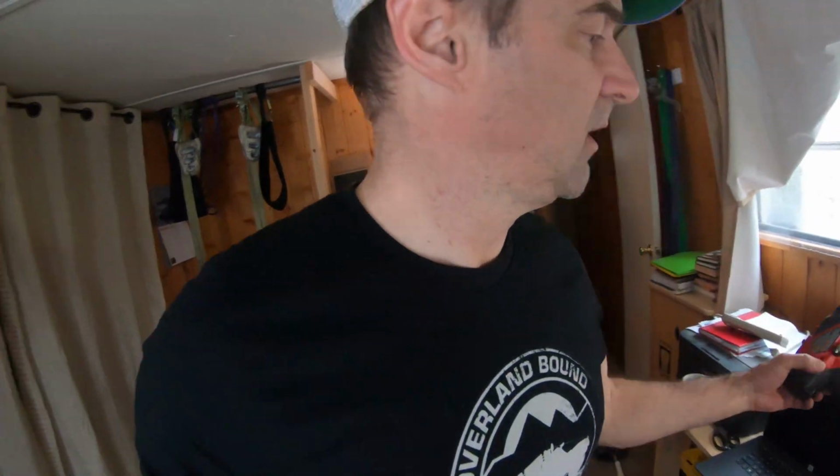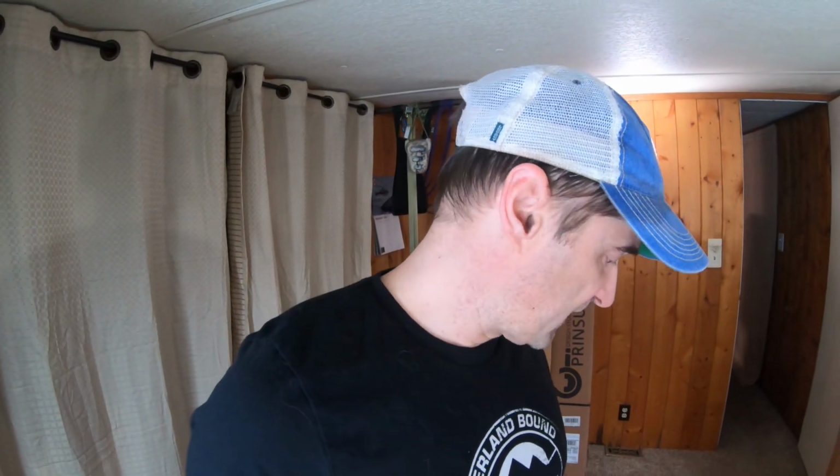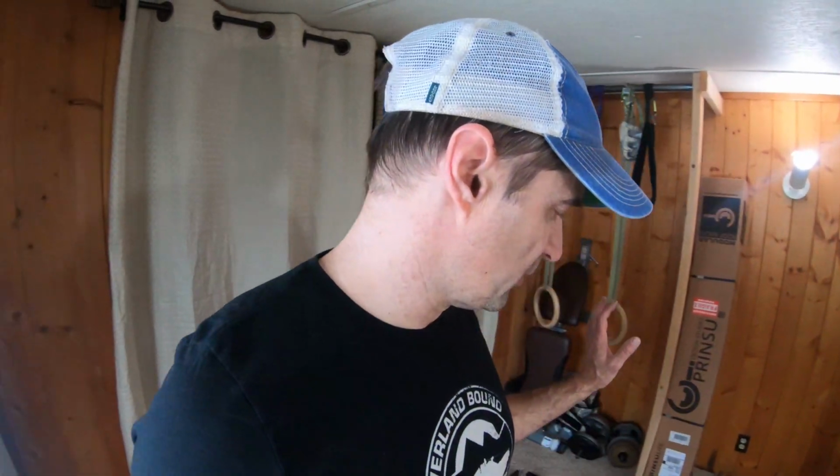So go ahead and hand start all of them, and then go back around with the drill driver or whatever you're using. I'm using that 20-year-old drill driver. And I'm going to set the torque setting pretty low. So I don't want to torque them all down really, really hard just yet. I'll save that for the last step, okay? So that's how I like to do it. Lay everything out so it's where it needs to be, and then get to town.